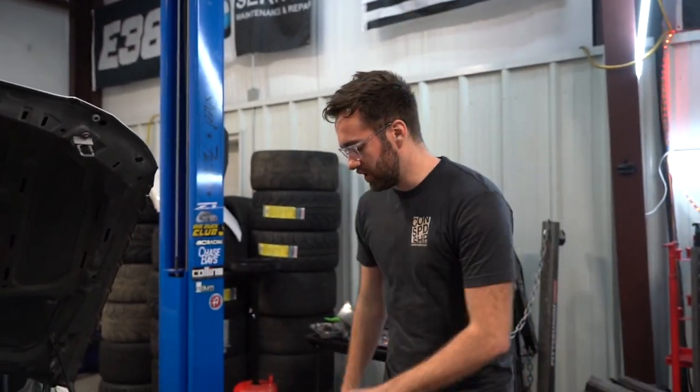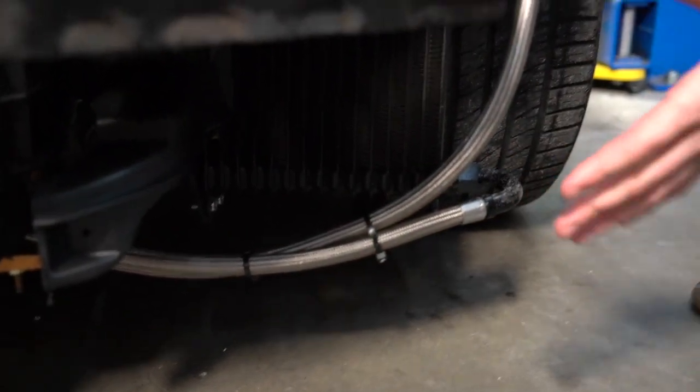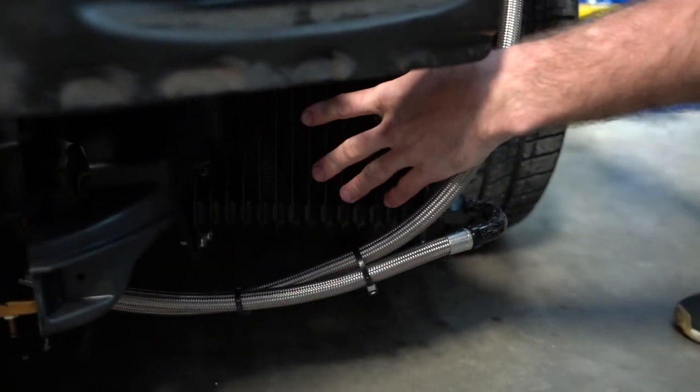We just got back from the test drive. What I ended up doing for the cooler was starting it up, letting the fluid move throughout the system to fill the cooler a little bit, then we got it up in the air and topped it off — it was down about a quart, maybe a quart and a half. Not sure how much fluid that cooler actually holds, but we got more trans fluid in there. Nothing's leaking. I really like how it turned out. We still need to work on the zip tie lines a little bit, but you can situate them how you please. The bumper will go over here, but you should be able to see a little bit of the cooler through the air duct from the bumper, which is really nice. Lines look cool, everything looks really nice — really good product. Make sure to check them out in the description.